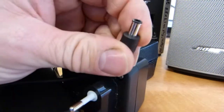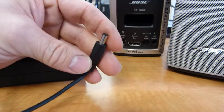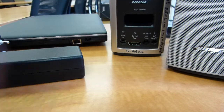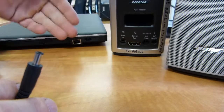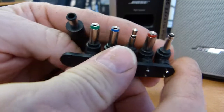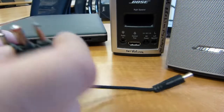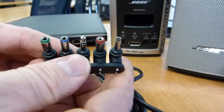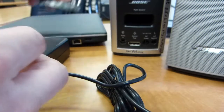They also have a proper end plug that fits your device that you want to operate. These end plugs just need to be matching. Not all of them are this barrel shaped — some of them are rectangular. Even the ones that are barrel shaped are all standard or standardized. So you can't just say, 'I need a power supply unit to run my Lenovo and it just has a standard plug.' These all have names or numbers and you need to know exactly which one fits.